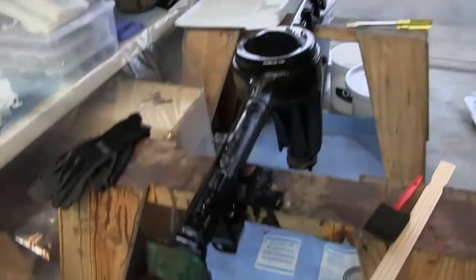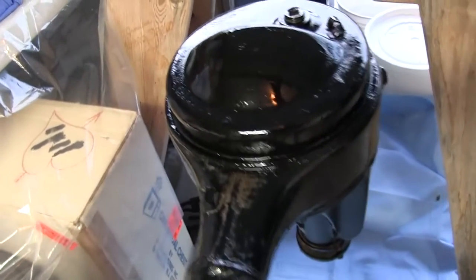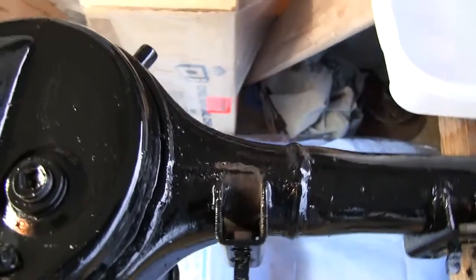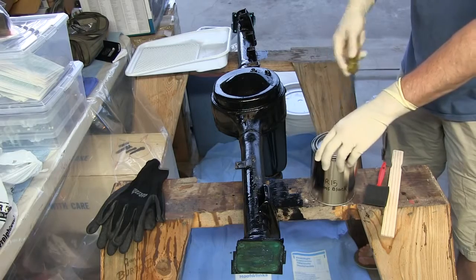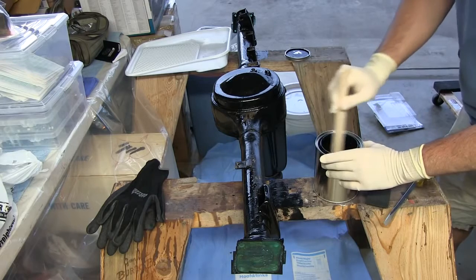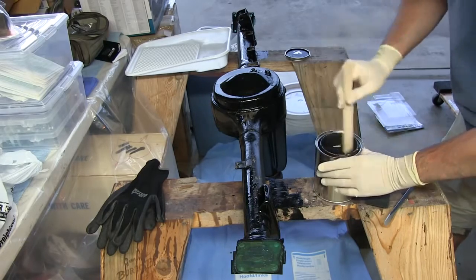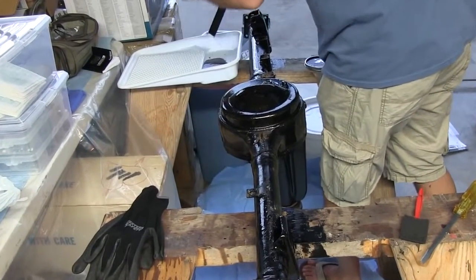The paint's finally dried on the differential. The backside had some spots that didn't get enough paint, so I flipped it over to finish it off indoors — it's getting dark. As I applied the first and second coat to the top side, I was dipping my paintbrush straight into the can. Only thing you should be dipping in the can is a stirring stick — stirred, not shaken. The theory is that there are contaminants on the brush. Always pour what you need into a separate container.